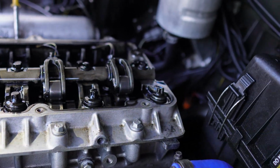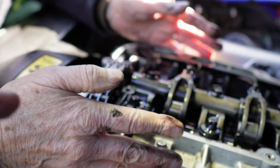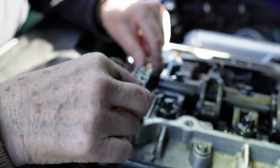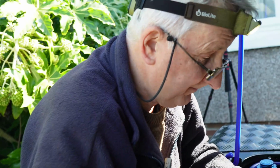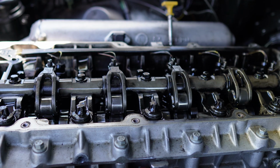It comes out through this way, I believe. Take that sprocket off. That stays. So the chain stays. Yeah, stays there on that sprocket. It's very good, actually, because you can take the 2 bolts out or 3 bolts in there, and that just only drops down a fraction, and the chain never comes off the teeth. So the timing between the crank and the cam never alters. Right. Okay. So yeah, it's good. Excellent. So there's no adjustment needed, you reckon? Pardon?